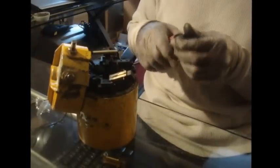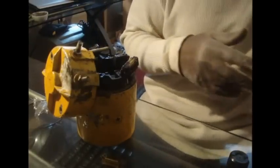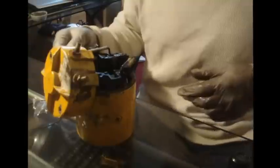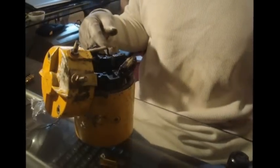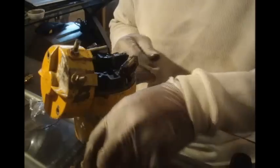Now what we're going to do, I'm going to hit this with a little bit of cleaner — just a little bit of electrical contact cleaner, something that dries fast. You don't want to spray any WD-40 or anything like that in there. I have a little towel here to dry things off and I'm also going to wire brush around the edges. Basically one at a time we're going to replace the brushes.